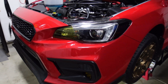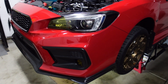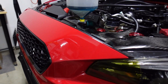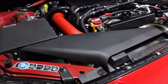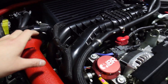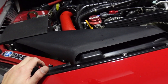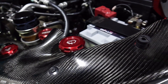I'm a little anxious but I think all I have to do is crank the car, hopefully it doesn't start, do that for a little while, then drop the car and go for a drive. Big shout out to SoCal Porting for rebuilding my turbo — I'm following their break-in procedure. If you've worked with new couplers before, you know how difficult it is to install pipes because they don't stretch as much as old ones — that's why it took me a little longer.